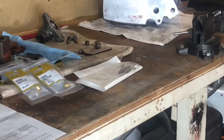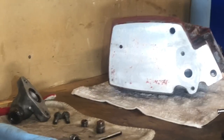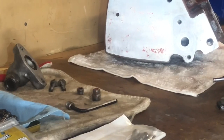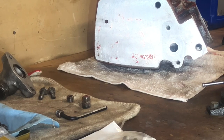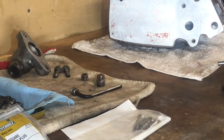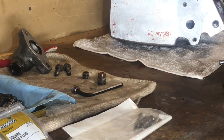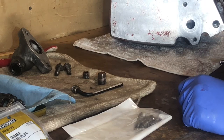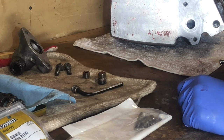Alright gang, we are going to attack the lower area here. This is going to be very simple. We've got a plug on the far right, the anchor o-ring mount plug, and then the actual drain plug. There's also an expansion plug — aluminum and any metal will expand with hot and cold, so this thing expands and contracts and needs some flex. This is probably a brass plug, some sort of soft-yet-strong metal that can absorb heat fluctuation.